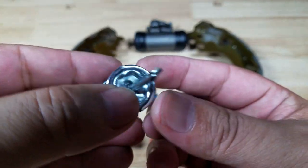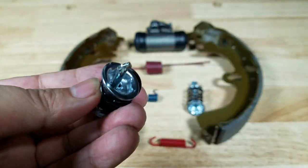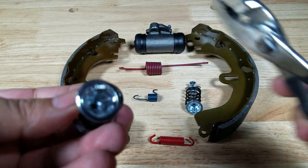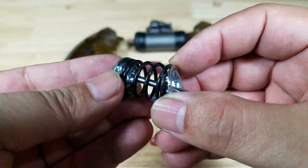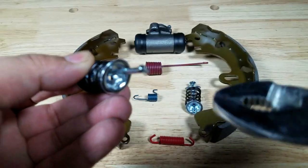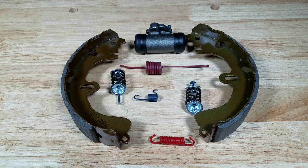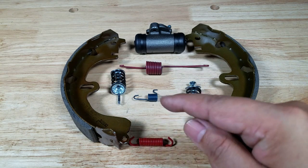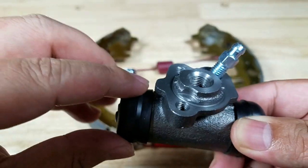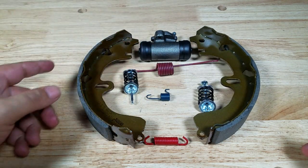Next up are the spring pins. There's a little slot and you need to turn it to release it. I'll come in with pliers, push the spring down and turn it. They do have special tools for this — I'll leave links in the description — but you don't really need them. Wrap your hand around the backing plate, hold the pin to stop it from turning, push in and turn to release. Do both sides. Then the spring unhooks from these areas, and last is the brake cylinder — just two 10-millimeter bolts in the back. Because we're removing the brake cylinder, you'll have to bleed the brakes, so have brake fluid available and make sure you have the correct cylinder for your vehicle.